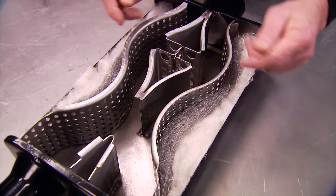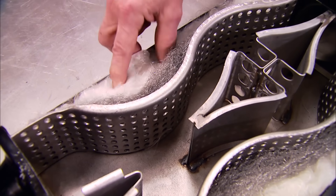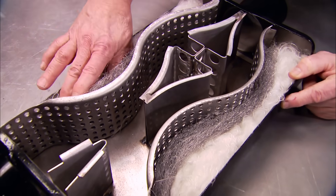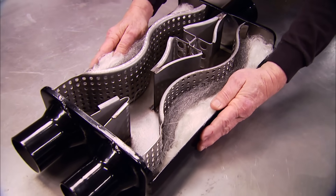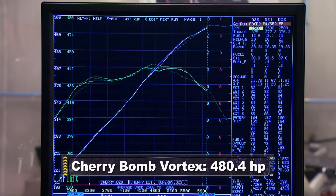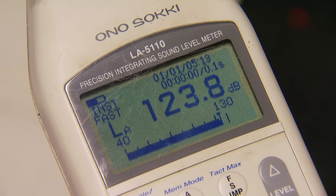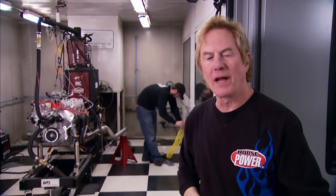Finally, Cherry Bomb's Vortex uses all the principles of the other mufflers plus flow dividers that push exhaust through perforated holes, steel wool, and fiberglass to eliminate drone. At the same time there's as much flow as you get in a four-inch pipe, so it's made for all-out flow and all-out sound control. No big surprise — the Vortex allowed the most power at 480.4 horsepower while staying several decibels quieter than the glass pack. So while the Cherry Bombs beat out the stock mufflers in horsepower, the top performers were the newer Vortex and the retro glass pack. Do you want to politely blow past other cars or disturb the peace? Your call.